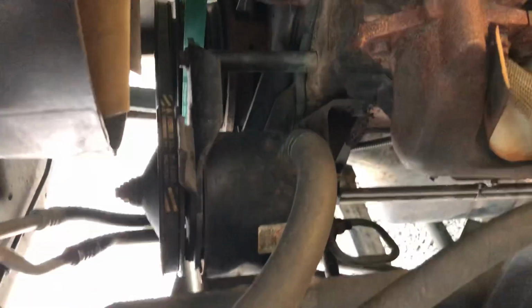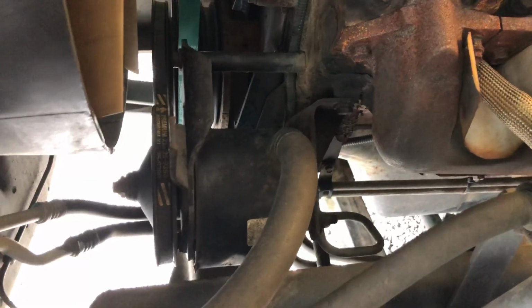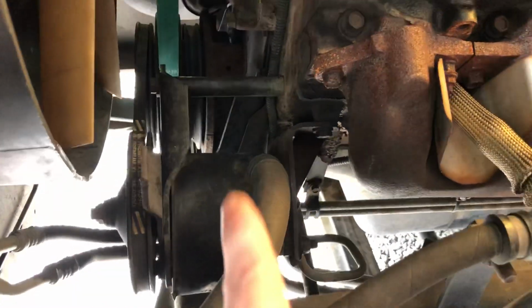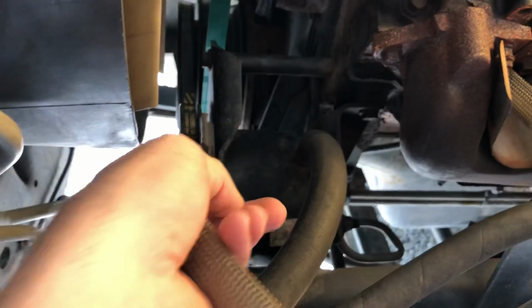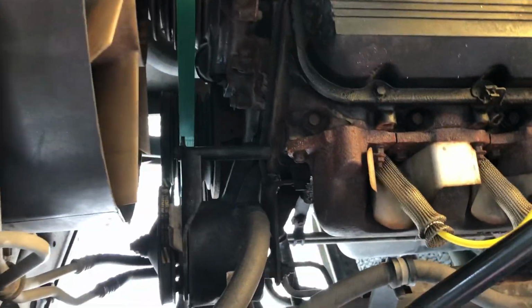There was a lot of bolts and a lot of removing items, and a lot of scratching my head as to what's going on here, because what looks like would make sense in a normal loosen that pivot bolt and loosen a bolt down here and just pivot that thing down, it ain't that way. There's something unique going on with this, so basically I wound up removing all the bolts and just pulling the whole thing loose and taking the belt off and then putting everything right back where it was. So I maintained the same tension and everything, but I've yet to figure out how you're really supposed to tension this pump. There's some holes in the pulley where it looks like there's some bolts in the front, and there's also bolts in the back, which I did take loose, but you can't get anything in here without removing that pulley to tighten that up. So I'm beside myself on that one, but anyway, I managed to get it off.